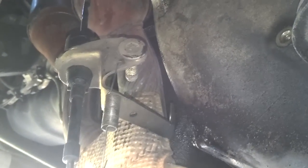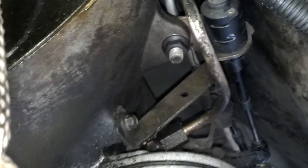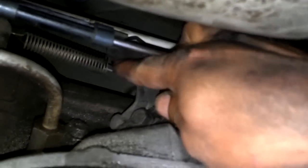I got the crank sensor back on with the wire bracket protecting the wires. Now I'm going to come back here and re-hook up this cable assembly. I got the bracket put back in for the cable shifter, got the top of the arm clipped back on the linkage, and got the spring back attached.